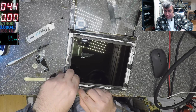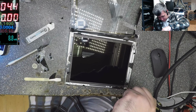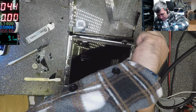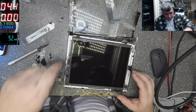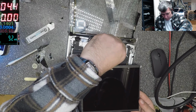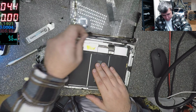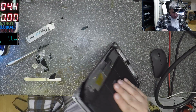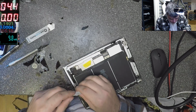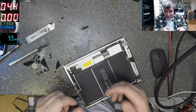Who knows, maybe one of the subscribers did this job. Maybe he can hear me. Okay, let's take the screen out. And after that we can clean the frame. Yeah, the screen is out. Let's take the digitizer. The digitizer is out. Let's clean the frame, yeah? Because if you have a tiny piece of glass on the frame, your new digitizer will get cracked when you press.